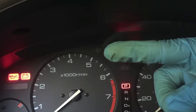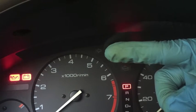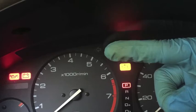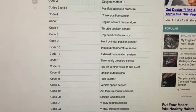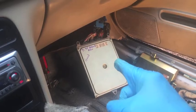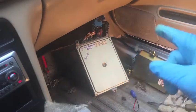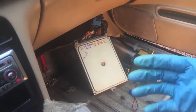You could also have multiple codes. If that were the case, after code 14 there would be an even longer pause followed by a second sequence of flashes for your second trouble code, and possibly a third. For us we have one trouble code, which is 14. On the list of Honda and Acura OBD1 codes, 14 is idle air control valve or bad ECM. Since I just swapped in this junkyard ECU and immediately got a code 14, I'm going with the 14 telling me this ECU is bad. I'm going to take that bad ECU out and put back the one that's been in my car for years, and you'll see the car runs fine.